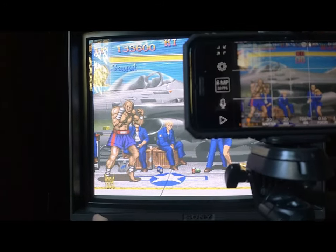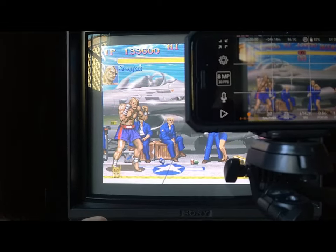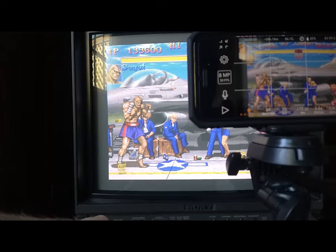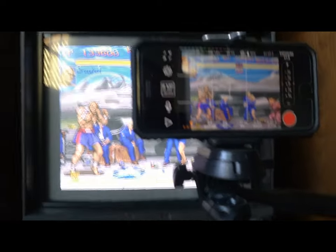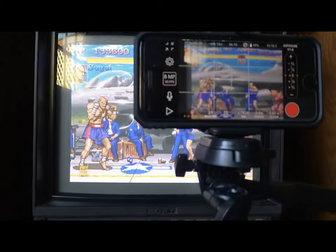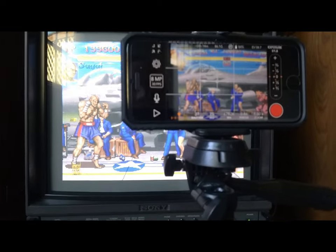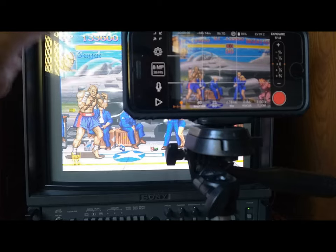Check this out — I hit the button and it underscans. That's going to make this 20-inch CRT more like an 18-inch or something like that, and that helps. The deal with that is you'll get more moire pattern on the screen — like these wavy lines.